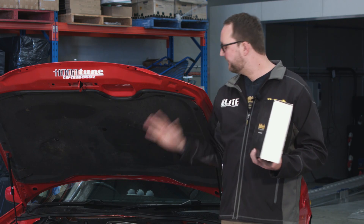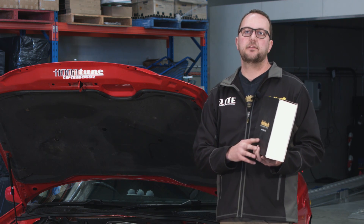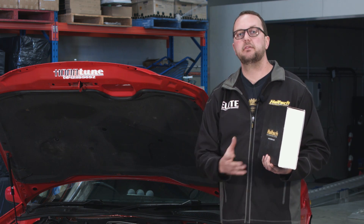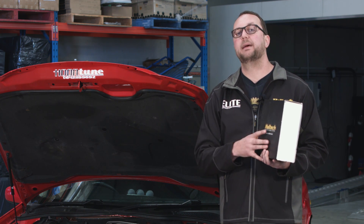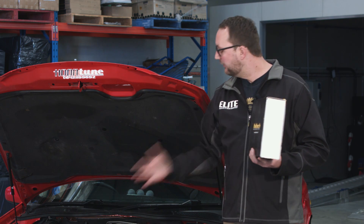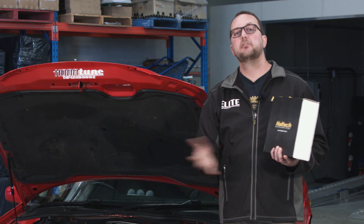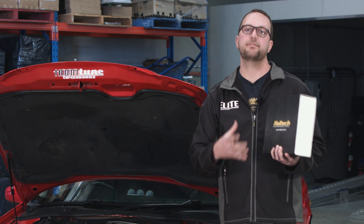The next part that is different for the Falcon guys — something we're not really used to — is where the Falcons were primarily flash tuned. That means we plug a laptop in through the OBD port and adjust all of the settings inside the factory computer. This is a really good way to tune some cars, until the car's making a heap of power or we've made some big changes that the factory computer doesn't really like, or it's really hard to manipulate the tune. Aftermarket camshafts, for example, are very difficult to tune in. With our Elite Pro Plug-in we can simply plug it in and tune the car just like you're used to on any other Haltech product, so we don't have any limitations of a factory system.